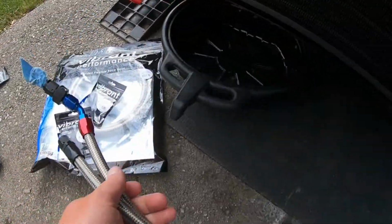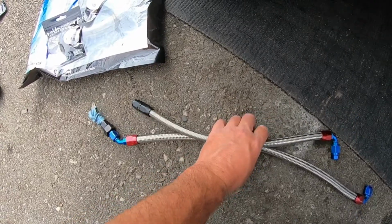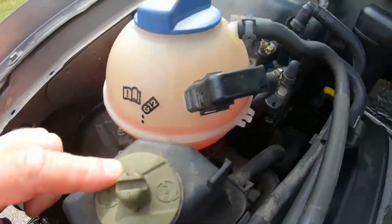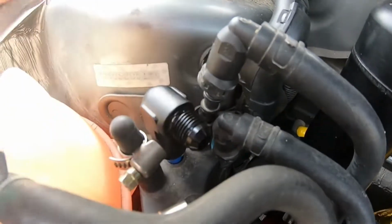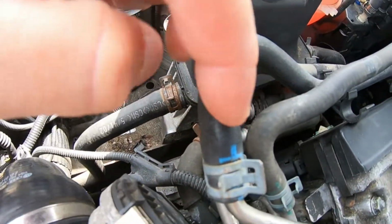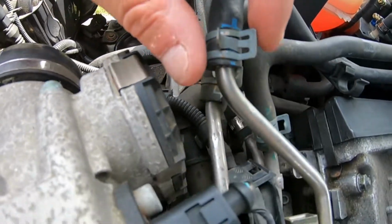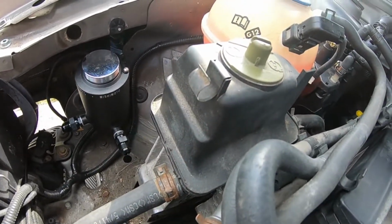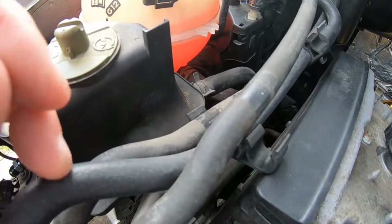And we also got our stuff for our fuel lines, so I'm gonna have to trim these up. These are from the Camaro project, which thankfully I kept. Once we get rid of this thing right here, you can see I already have a 5/16 quick connect to a Dash 6 AN. We're gonna run a 90 off of that, and then go into the fuel rail here using a 90, and then go from AN line to barb, which will allow me to run just a wee bit of hose to get back on the stock fuel rail. Yeah, we'll get all that done. Should look cleaner when all this stuff is out. But most importantly, the braided lines, again guys, are a little bit sturdier, so pretty happy with that.